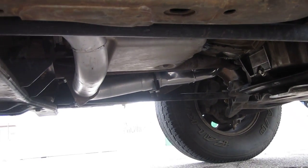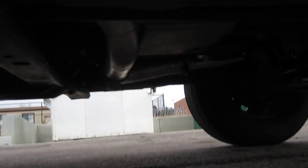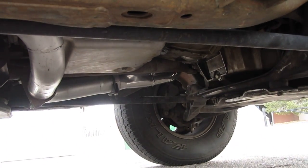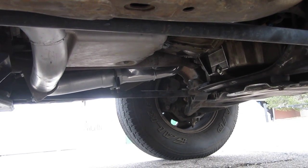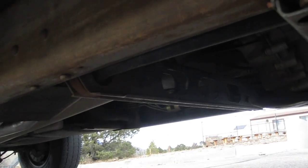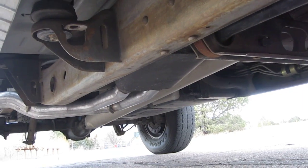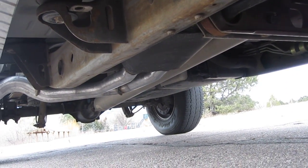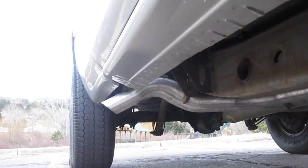not a spot for them on the new ones because you're not gonna be using catalytic converters, but you still need to reuse your front O2 sensors, which screw into the back side of your exhaust manifold. And as you can see, I put that under there, and then it goes from the muffler 3-inch in to duals 2.5-inch outs. Then I routed them underneath here.